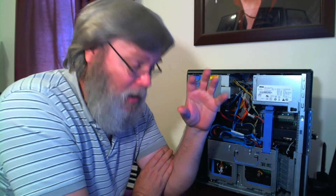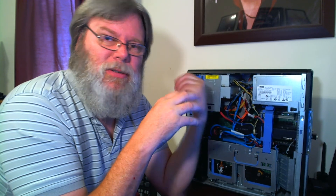Another thing: change the CMOS battery on the motherboard. If your system's CMOS battery goes bad — not necessarily this model, but many computers — they'll act weird. They'll boot up really slow, or won't boot properly, or have all kinds of little issues. If your computer starts behaving strangely, change your CMOS battery. A lot of times that will fix it.